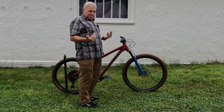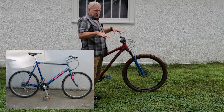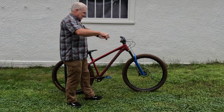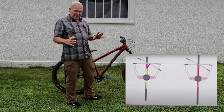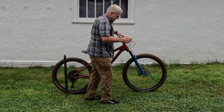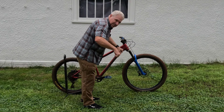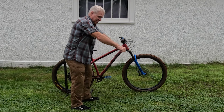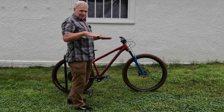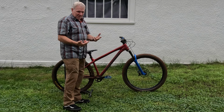down. So if you think of old mountain bikes where you had shorter frames and we had these long stems on them, trust me, I've been riding mountain bikes for a long time, since the late 80s, throughout the 90s and stuff. And this long stem always made the bike sketchy, because whenever I was standing on the bike riding and I stood up and leaned forward, the front wheel was tucked back underneath. And so as soon as the bike pitched over, all my weight's forward. And then I would have to lean back like I showed you, but I could never lean back far enough to make it not feel super sketchy. And yes, there were times I went over the bars because of that.